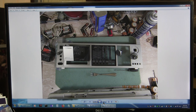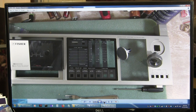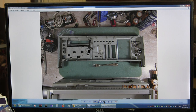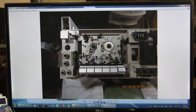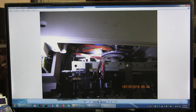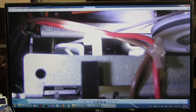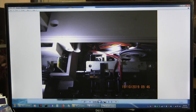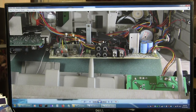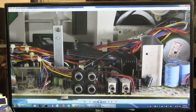Here's the front coming off. The door stays with the front. There's the mix mic input and two knobs here — one is for shortwave and the other one's for fine tuning. And there's the tape deck. It only takes two screws to remove it, but you can't fully remove it because this right here is your recording bar that goes back to the motherboard, and that's really difficult to get off. You can't release it from here — you have to release it from the motherboard.